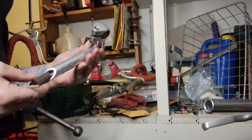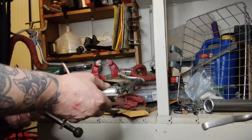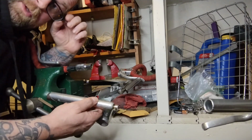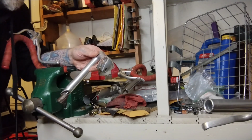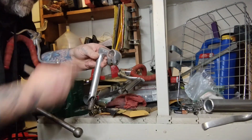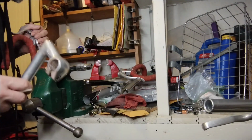These things are absolutely great for making people's bikes fit, especially small women, people with short arms. Short people have the unfortunate problem of still needing their bike to be very long to clear the front wheel, so you don't have a bunch of toe overlap and wreck. So often, as frames get smaller and smaller, the top tubes stay too long. So a nice, tall, short stem, well, it brings a short person up and back. Saves the day.